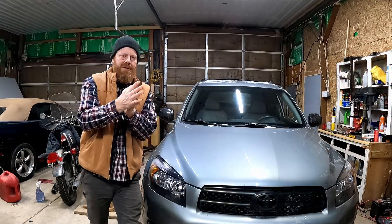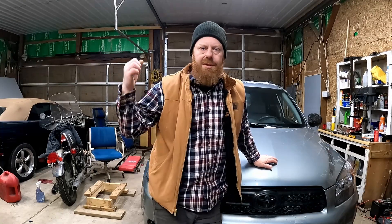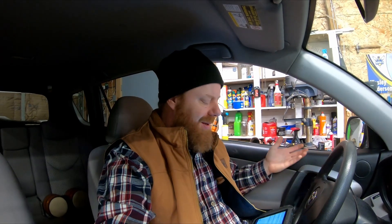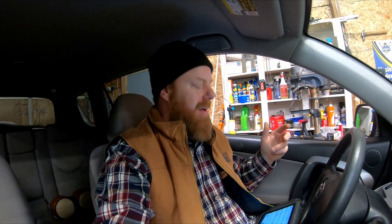We're inside where it's warm. It ran for about 30 minutes while I was doing all that, so I'd imagine it's okay — it was probably just out of gas — but we need to double check. Let's run the scan tool on it. I'm not sure what year this is, but maybe it's new enough to show fuel pressure. Unfortunately there's no fuel pressure data available, but there are no codes, no misfire data, and the air-fuel ratio looks good — it's not showing a lean condition like the pump is starving. I suspect it was just out of fuel.